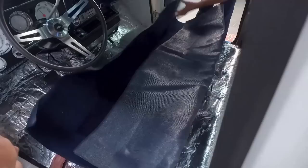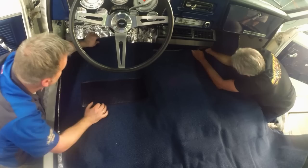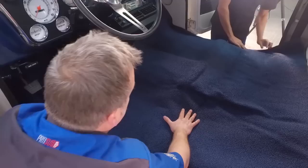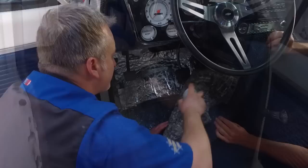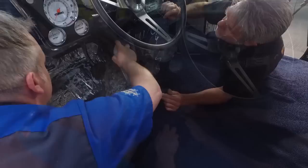Now onto the carpet. The temptation is to just throw it in the truck and go, but take your time. Set it out in the sun to get nice and warm and malleable — it's a molded carpet, actually shaped to fit on the floor with the same bumps and humps. After it's warmed up, put it in the cab. If you can, leave it in there for days — the longer it sits, the better it molds in. Start at the front just like with the heat shield, glue it down, make sure your buddy's holding the carpet firm because it'll jiggle around. When you glue this down, you're in it. Get the front nice and secure, roll the back of the carpet forward, lay down your glue on the jute bottom of the carpet and on the silver top of the heat shield so everything sticks really well. Roll it back with your hands, mark the holes as you go, and keep rolling to the back end.